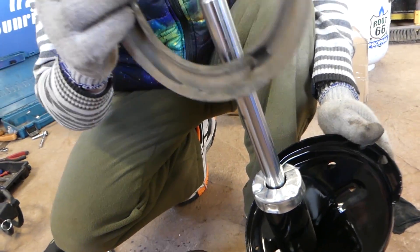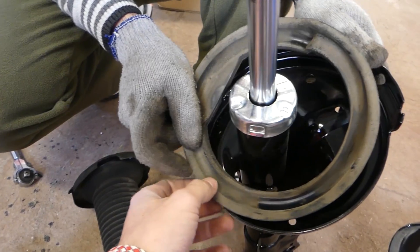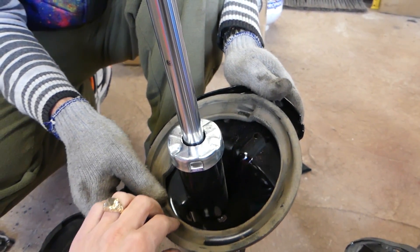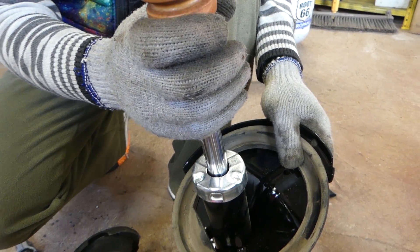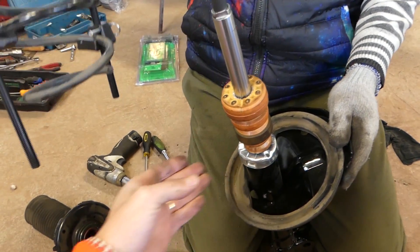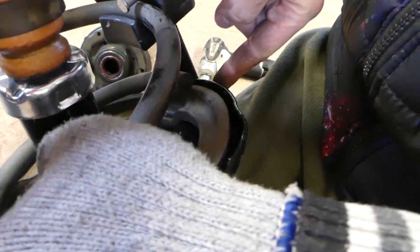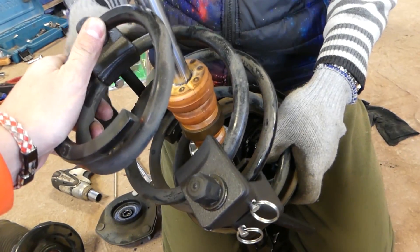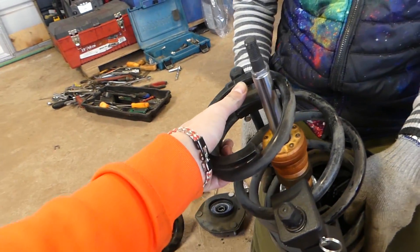It's important to install everything exactly the same way you took it apart. You can see there's a spot for the spring that it attaches on the bottom. Usually all cars are about the same, especially front suspension. Next, we need to get the shock absorber in — push it in. After that, install the spring again. Do not stand in the way of the spring. Make sure that bottom piece is going in the groove and lining up properly, because it's going to contact there once the spring is installed. It needs to be in the same spot as on the old strut.